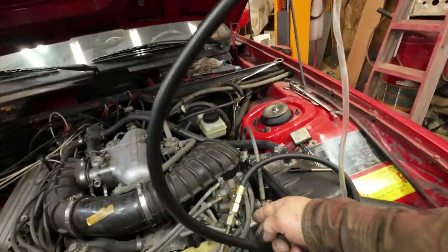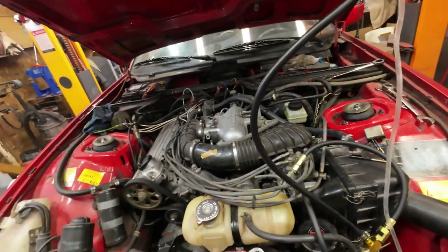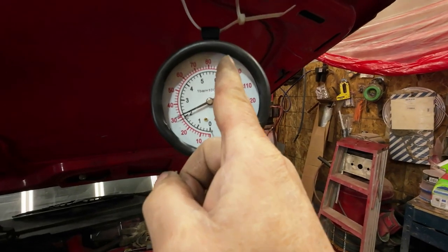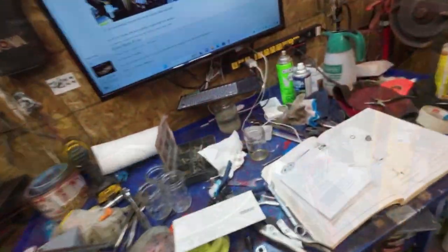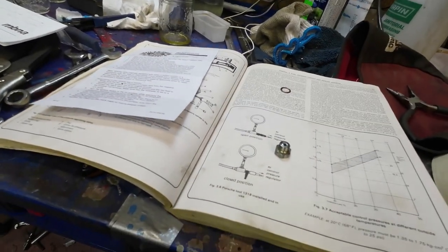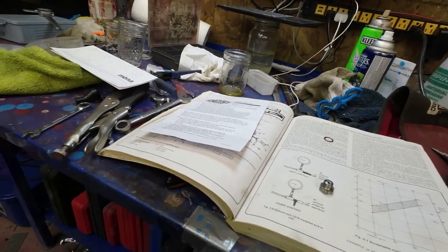Now, I'll take this out of here and remove a couple of those shims, because this has been up about here, and I want it to be about here. That's the proper pressure. Okay, now here I am. Here's the little gizmo thing, right? You see, the shims are right inside there. Now I've got a ton of them in. I put a whole bunch in there because it just wasn't coming up to pressure. But now that it's up to pressure, I'll remove some and try to get the pressure set properly.